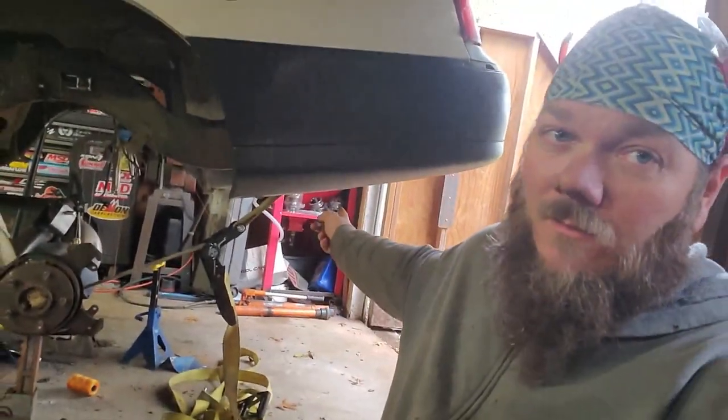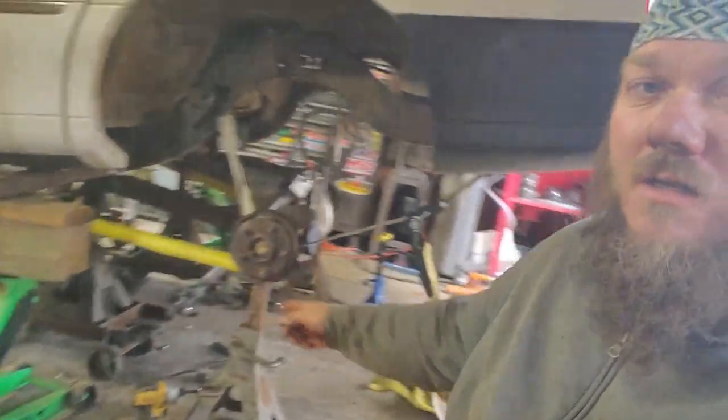So I figured I'd take a break and bring you guys up to speed. I've been doing some work and it's a little bit sketchier than usual — kind of one of those deals where the longer you look, the worse it gets. Pretty sketchy. Got me a jack stand in the middle of the body pretty much. We got the lower trailing arms connecting to the frame — I kind of didn't really want to do it that way, but that's how they're all done apparently. The bottom of the frame is a cool place to mount them, it works out good. But you have nowhere to jack it up, and I don't have a lift. So I'm having to think outside the box.